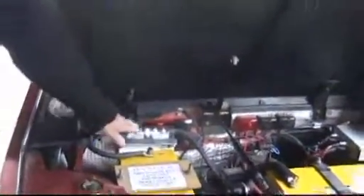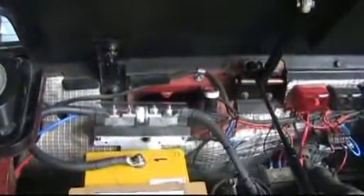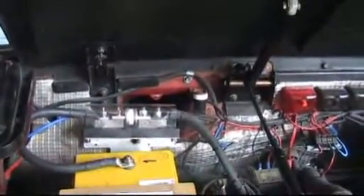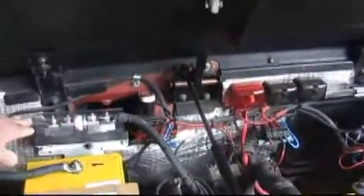You've got to have things like this special fuse. When you blow an ordinary car-type fuse up to about 80 volts they just blow, but over 80 volts they arc, and you end up with a little mini arc welder working all the way out to the motor, which is not quite where you want it. So that's a T-class fuse, and it's designed to blow and stay blown.